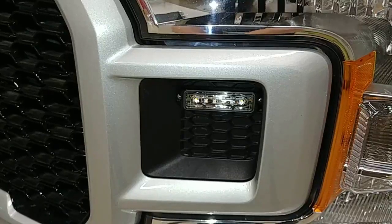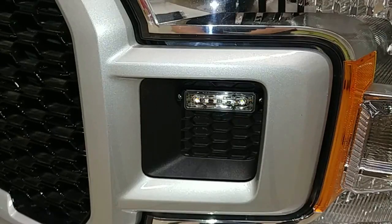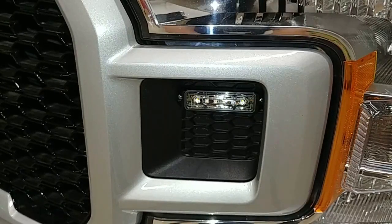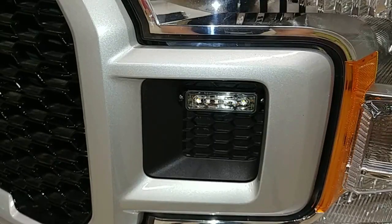There's a shot of that mounting right there in that little pocket on the grille. Many grilles have this area and you can fit a TIR-3 horizontally or vertically, as well as a LIN-6 horizontally or vertically. Personally, I like to mount the LIN-6 horizontally like this because I believe it takes better advantage of the optics and spreads the light out a little nicer.